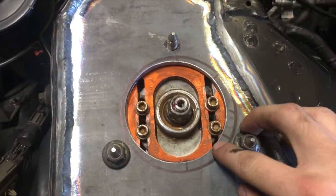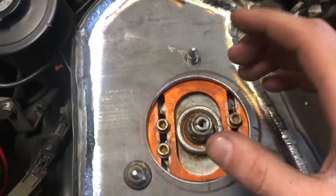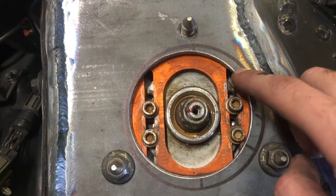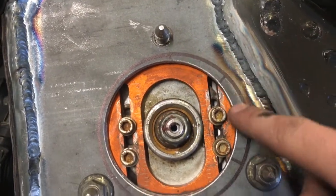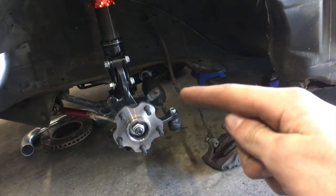It's been a super long day but we've made massive progress. Got the center hole cut out - pain in the ass. Got the coilover bolt holes drilled - also a pain in the ass. Wound up breaking through five bits and one cone bit, but I finally got enough wiggle room to get the coilover actually on. I still have a little bit of a gap on both sides but I was able to get the bolts installed without any side-to-side motion so it fits well. Tomorrow I'll get a deburring tool to clean up the angle, and I need to order an S13 front sway bar and adjust the inner and outer tie rods for proper steering.